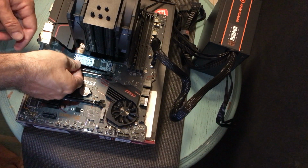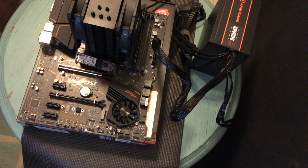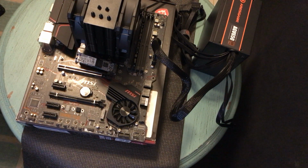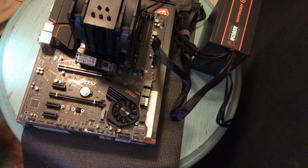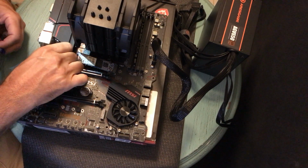Oh, see there. Yeah, so there I screwed up. That won't boot. That's the wrong one, mainly because I had the GPU plugged in as well. I forget there's a rule, and I couldn't find it stated in the manual. I know if you use that M2 slot and use a PCIe slot next to it, you can't use both. There's something stupid like that. I can't remember, and again, it wasn't in the MSI handbook manual. So I ended up moving to slot 2, and it will boot up eventually.